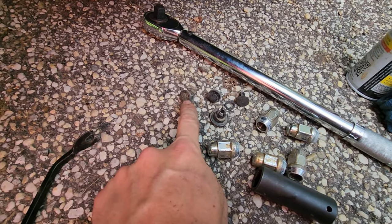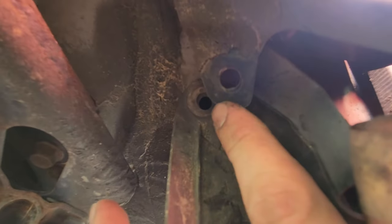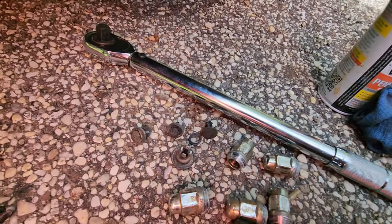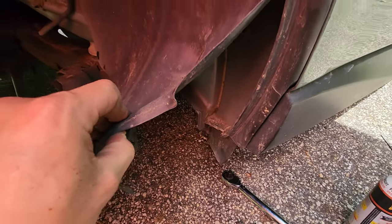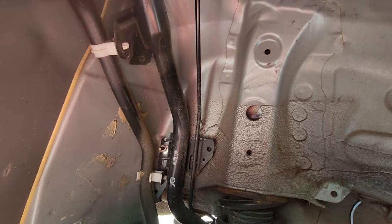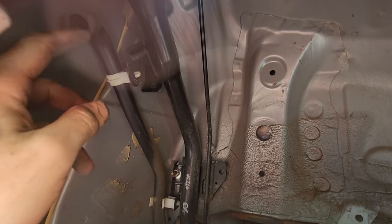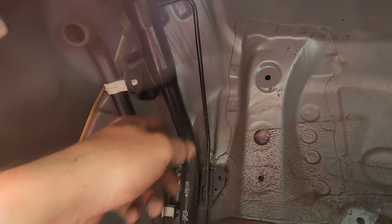In pulling the cowl I found another fastener — there were two holes holding it into place. Now that it's removed, the whole thing peels out. The cowling lays in here; if you pull both sides together like you're squeezing a taco, it just pulls right out. Not much going on in here, which is great — I don't see any rust. Those are my fuel lines. We have the gas overflow line, which is new to me — apparently that goes up to the gas tank.